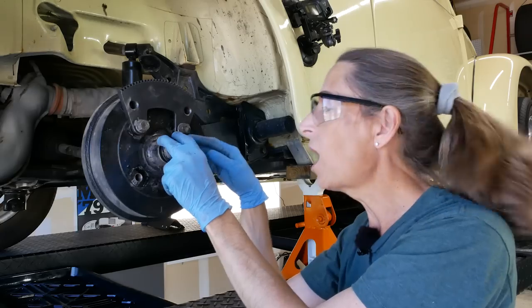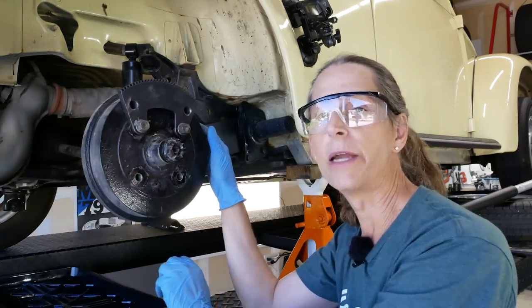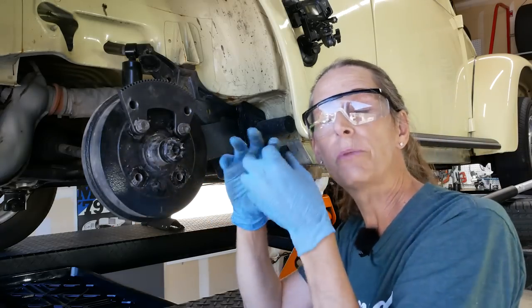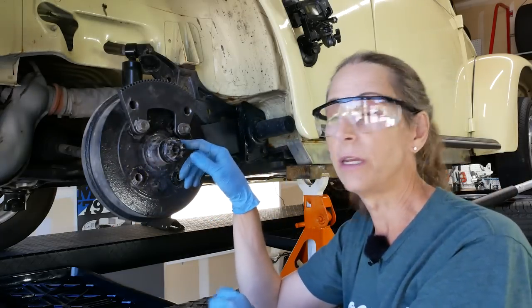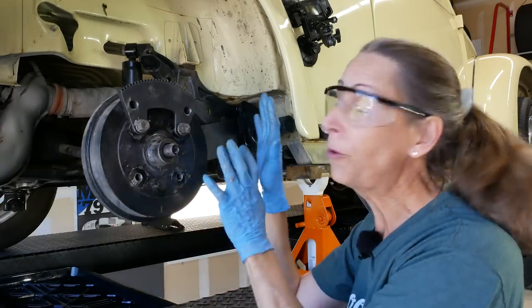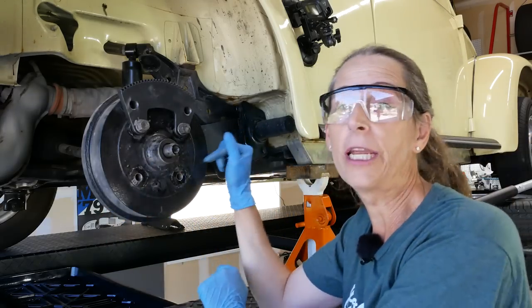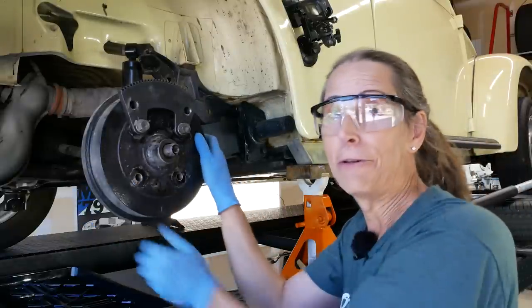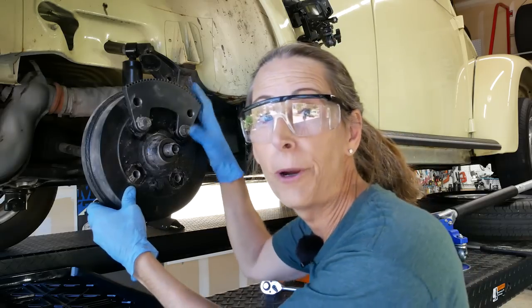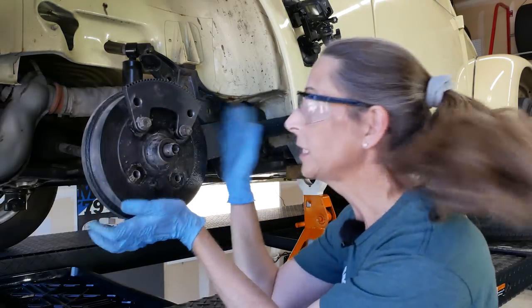The reason this torque is so high is because this inner axle is splined and the drum just sits on that spline. If it gets loose and isn't tight enough, you can completely destroy the splines on the drive — a very, very bad thing. Before you pull your brake drum off, make sure you've released the parking brake. You'll never get the drum off if the parking brake's on. Our parking brake is off — good sign, though I still have the car in gear.